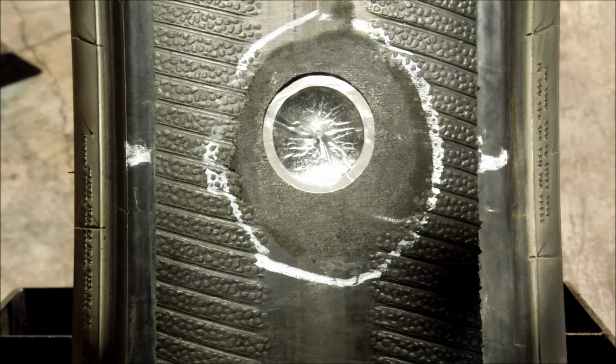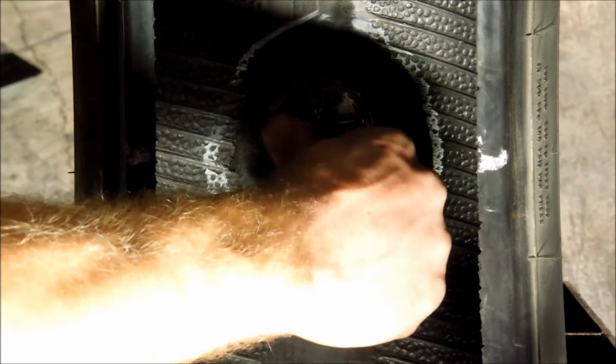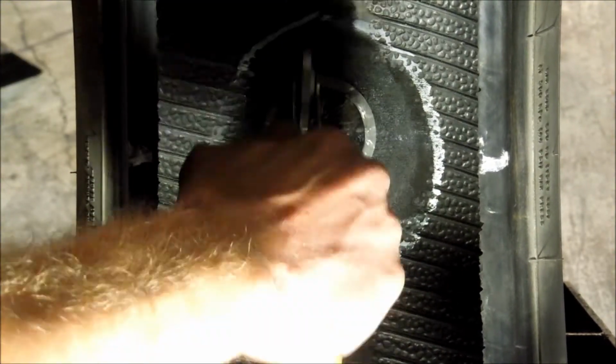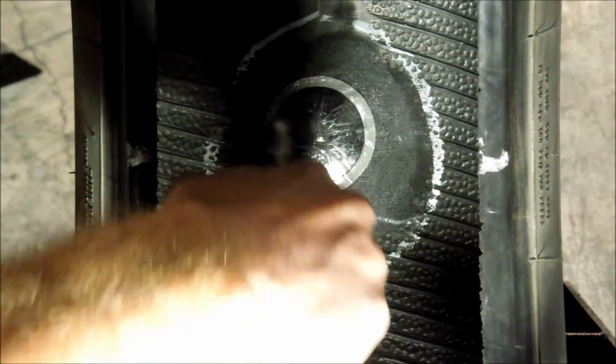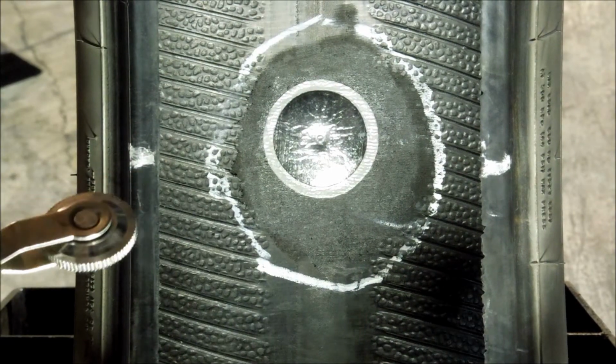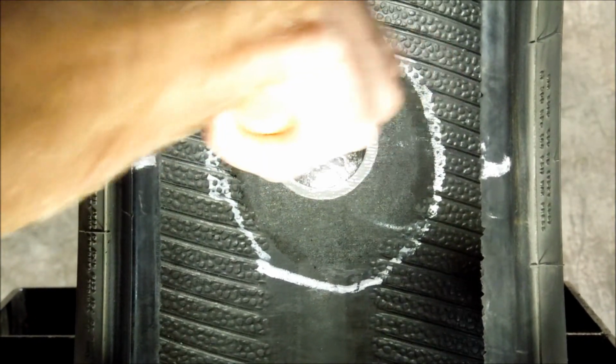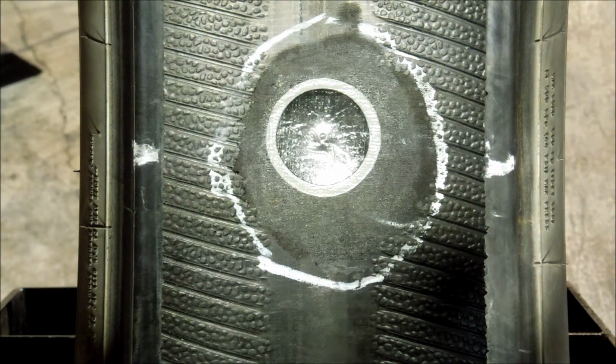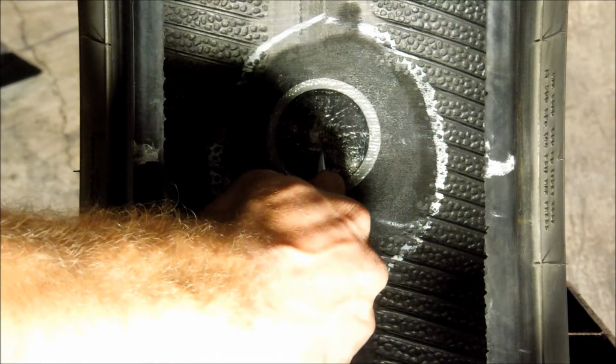Stitch the repair in place, working from the center towards the outside. Repeat this process by turning the stitcher 90 degrees. This will promote better adhesion and assist in eliminating trapped air from under the repair unit. Once the repair has been stitched into place, remove the clear poly protective from the top of the repair unit.